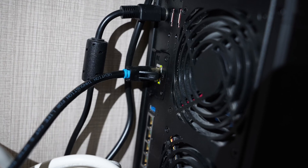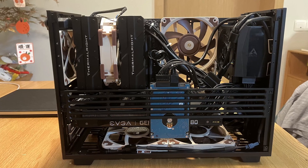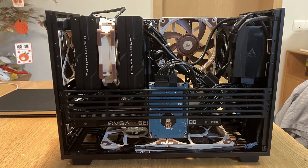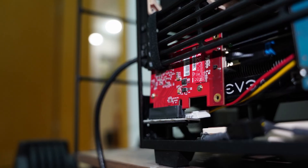With the router up and running, the next step was upgrading key devices to 10G. The NAS was super easy — Synology has a drop-in module for this, and it took probably less than a minute to pop it in. My PC, on the other hand, was far more complex. ITX builds typically don't have spare PCI slots, but I managed to use an M.2 to PCIe adapter and connected it to the second M.2 slot on the motherboard. It was tight, but it worked.